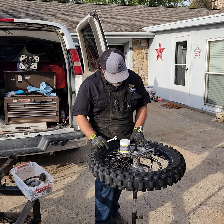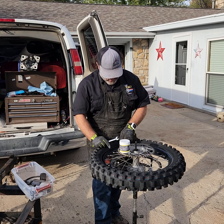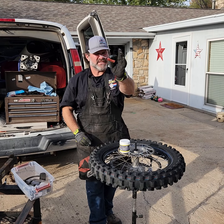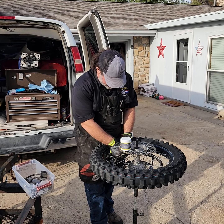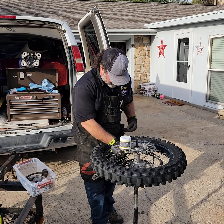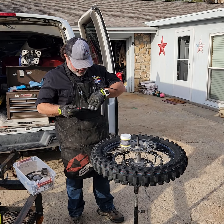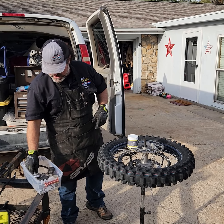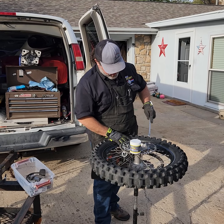These ratcheting wrenches are a lifesaver — they sneak right down in there really well. We're gonna take this rim lock nut out to flush. I've already got the air stem nut and cap off, but then we're gonna take this $5 little tool right here that's super handy — fit it down inside there and remove the core. Always put the hand down underneath where you can catch it. Put that back there and then Motion Pro spoons — these are really nice because they don't have any sharp edges, so they keep the rims in good shape.